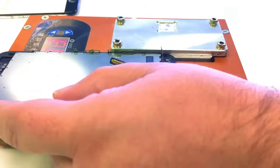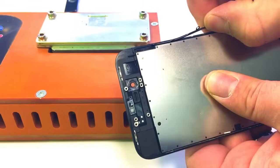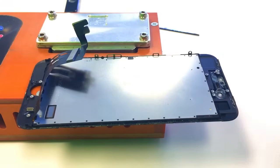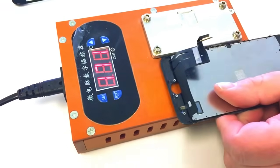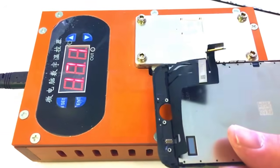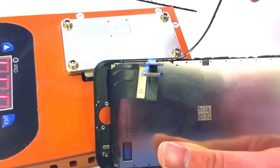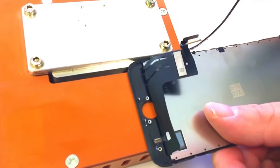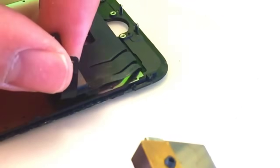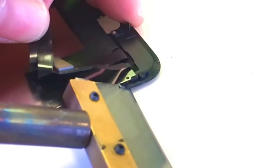The next thing I'm going to use is this heat plate. This allows me to heat up the sides of the screens to loosen the adhesive between the bezel and the glass, which allows me to simply pull it off after only a few seconds. By moving up and down and maintaining a continual motion, we distribute the heat evenly. Using my heat blade again I will be able to remove any pieces of the bezel that I haven't been able to remove, like this piece here in the corner.